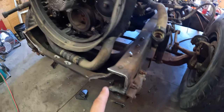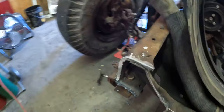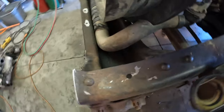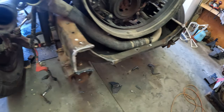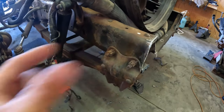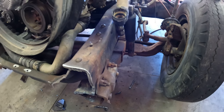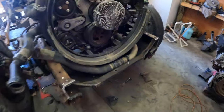So we just got the front of the frame cut off — you can see that — same with the other side. Remember this is going to be boxed in so we're not going to be losing any support. This cradle and front support is really wide — eight to ten inches — with rivets all the way throughout and bolts, so we still have the support and durability we need. We're just shortening the frame for the purpose of the coolant system. Next up we're going to figure out how to mock up mounts off the sides — we have some C-channel so we're going to try to utilize that for downward support for the coolant system.